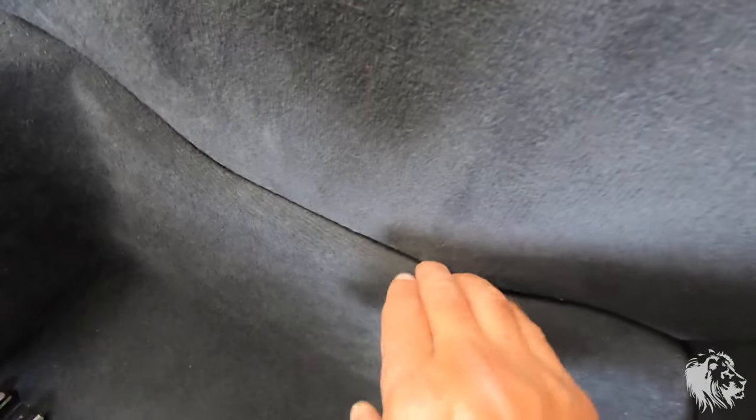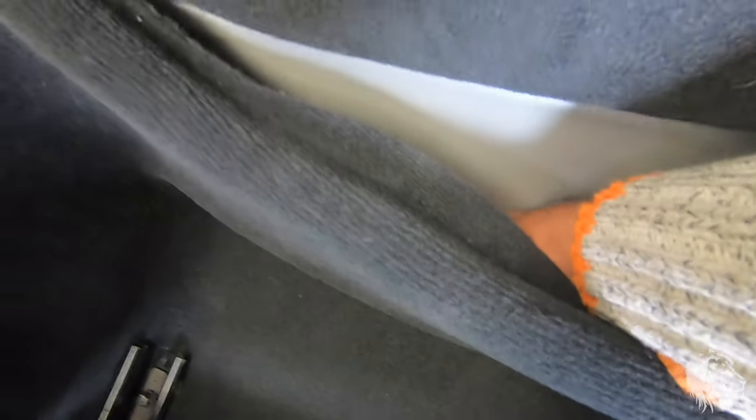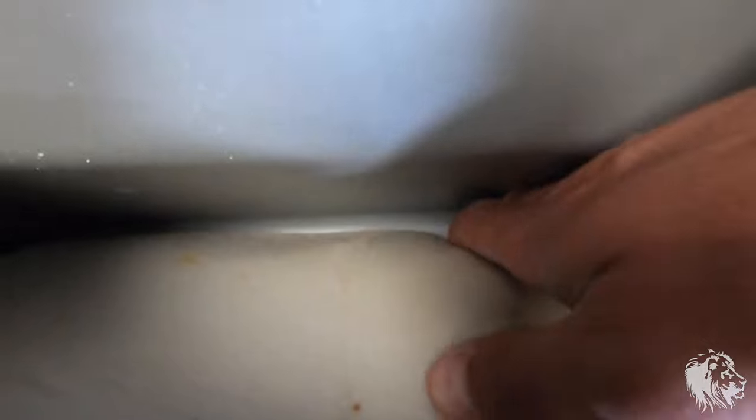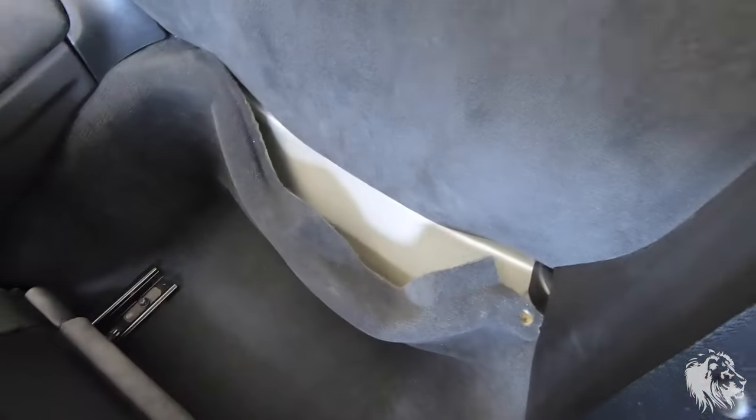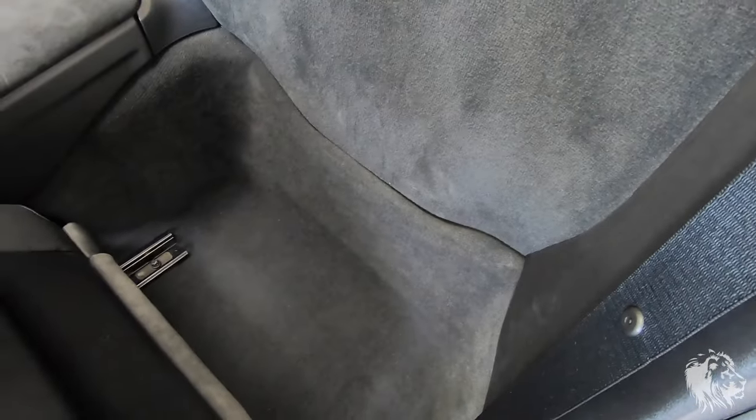On the 981, the carpet is higher up but there is a split and you can pull it forward and reach your hand round to feel for any wetness. If there's any dampness at all, you know water could be running down the side of the car, along these side bits, underneath the seat belt, and down into that area. This foam here should be free from dampness — it's something to check if you're looking to buy a car. Push it back and it molds back into place quite well.